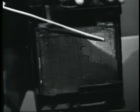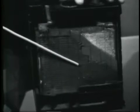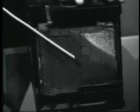The chemical reaction will cause the lead dioxide to become positive and the sponge lead negative, so a voltage will exist between the two. One cell of this battery develops about 2.2 volts, so to furnish the voltage required in most cars, 6 cells are arranged to develop an output of about 13.2 volts. Checking the cell arrangement, we would have about 2, 4, 6, 8, 10, 12, the ordinary 12-volt car battery.